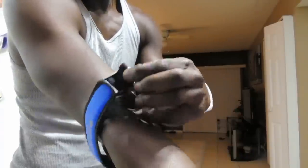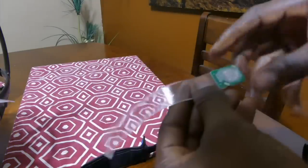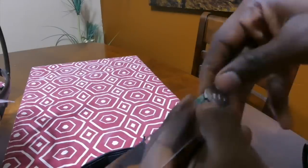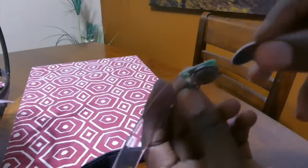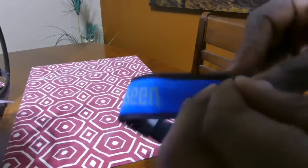Here's me putting on the device on my arm. This is the be-seen armband — I'm going to put this on just to show you how to do it. Simply grab this here and pull it. Here's how you change the battery: pull out this insert here. This device takes two batteries — push them up with your finger and they pop right out. Put both batteries back inside the device, one and two. Slide it back in and push it all the way inside — nice and tucked in. Cover the battery compartment and there you go.